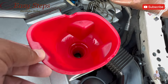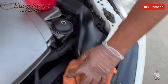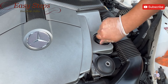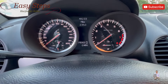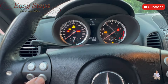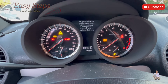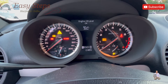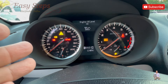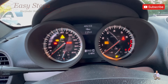There you can see — 2 quarts left. Now we're going to turn on the car and I'll show you how to check the oil level. Take out the funnel and close the engine cap. Put the key in position 2 and click the up or down arrow. It says 'engine oil level measuring now.' And there you have it — it shows engine oil level OK. If it were low, it would tell you to add a quart of oil. Since we already have 8 quarts in the system, we're going to give it a start.